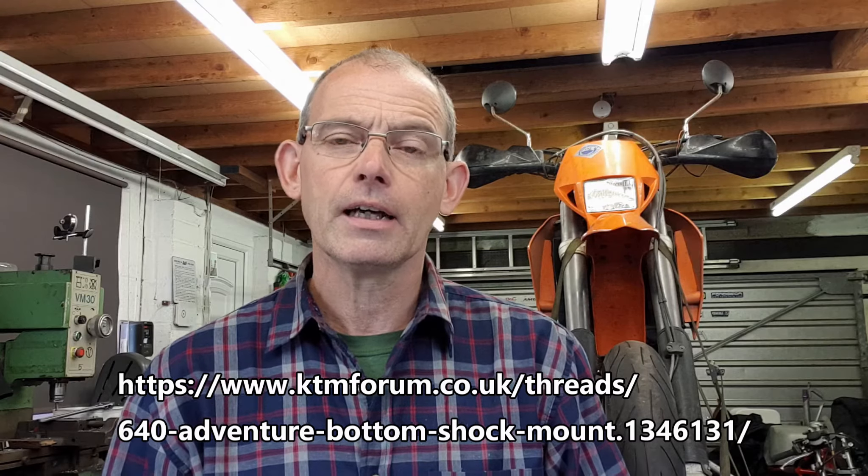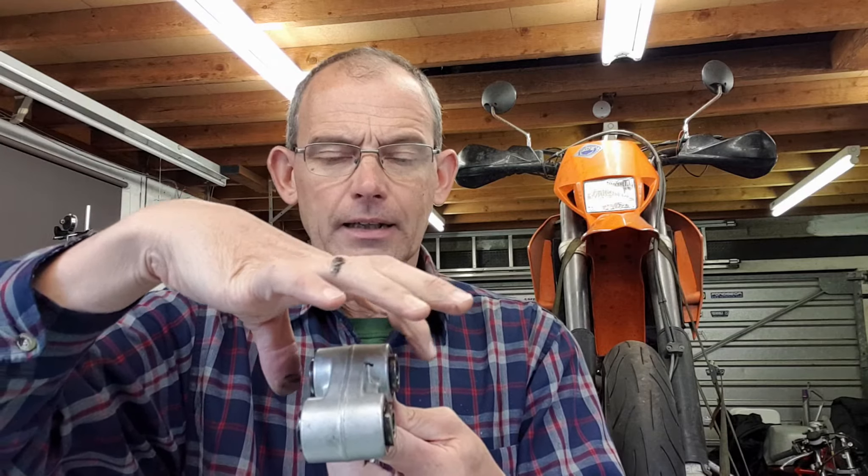The idea with a needle roller - the linkage is moving up and down on the suspension. There is a little bit of play in that bearing and a little bit of play in the swing arm, whereas the other bearings are really tight. So if there is a little bit of frame flex, it'll cope quite admirably. I'm not racing this thing, just having a lot of fun. Under extreme conditions if the frame's twisting and you hit a big bump, there may be a little bit more stiction for a fraction of a second - I can't see that being a big problem.